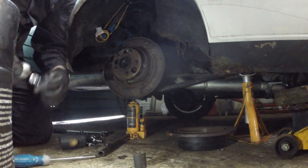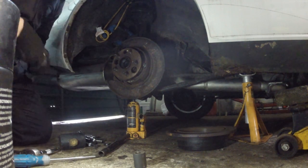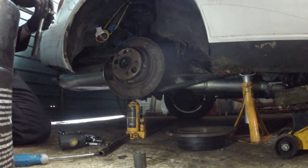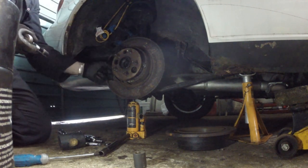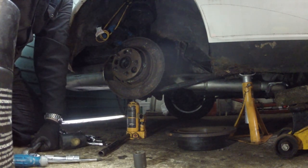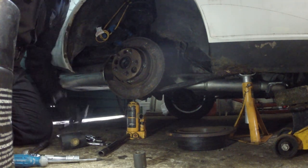14 millimeter bolts. I've got the big guns out with the half inch ratchet. I had to take the brake disc off and the caliper and the carrier. The carrier bolts were an absolute pig to undo, because to get round to the back, if you can see the holes there, there's not much spacing, so you can't get them with an impact gun or even a half inch ratchet. But a breaker bar, I could just get them with a breaker bar